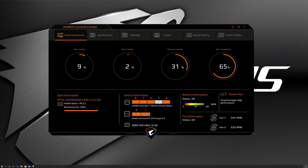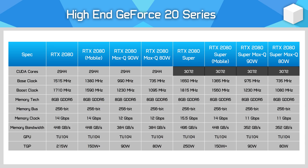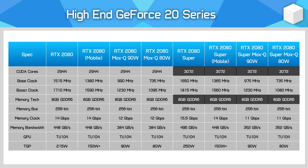Occasionally you can use software to toggle between the modes on one system, although you can't toggle Max-Q on or off. What remains constant within a certain model name, regardless of whether you get Max-Q or the higher power Max-P models, is the basic core and memory configuration. The RTX 2080 Super, for example, comes with 3072 CUDA cores — the same as the desktop variant — and 8 gigabytes of GDDR6 memory on a 256-bit bus, again the same across all RTX 2080 Super variants.